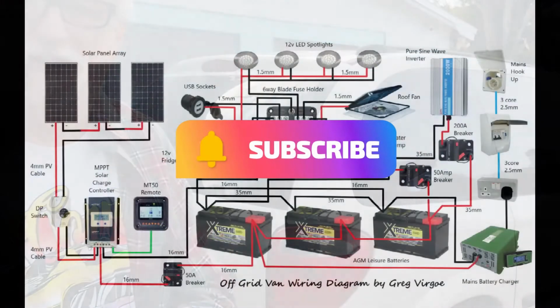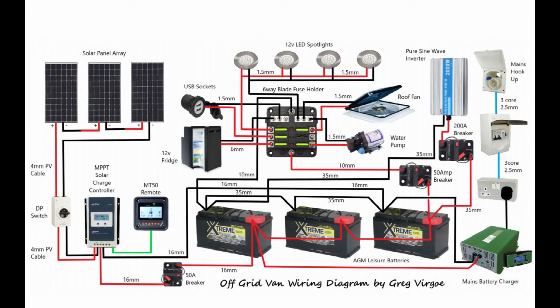Okay, now here's a system, and you can do this on your van. It has 3 solar panels, it has 3 batteries, it has the inverter, your converter that converts it from 12 volts to 110 volts. This particular one has hot water and all kinds of stuff. You could do that. But right here you're looking at probably, let's see, $1,500 in batteries and probably $1,000 in solar panels and maybe another $1,000 in other electrical parts or more. So you're looking at $4,000 or $5,000 for this system. Is this the right one for you? Could be, but not for me.